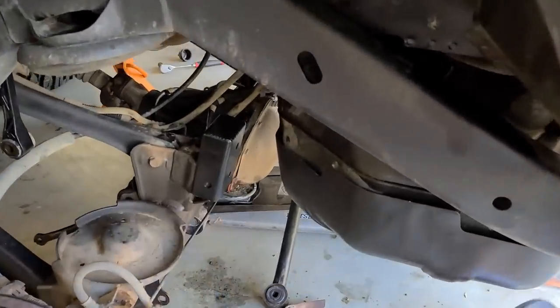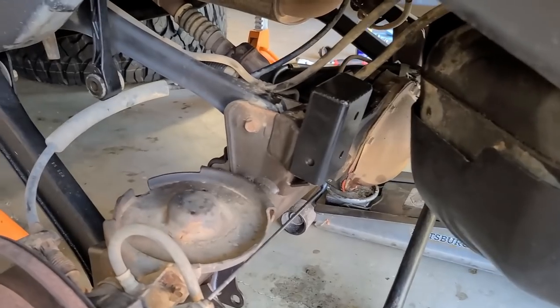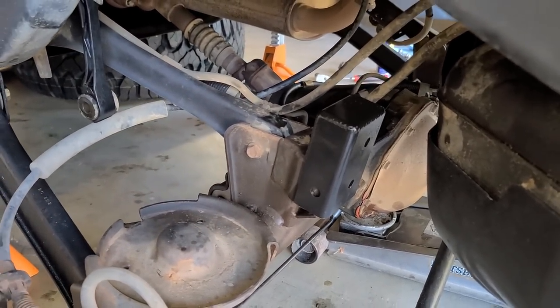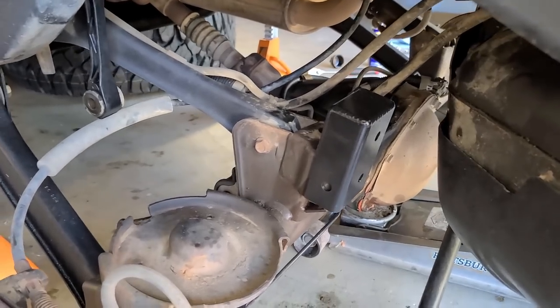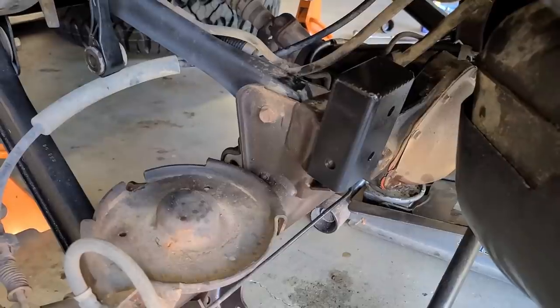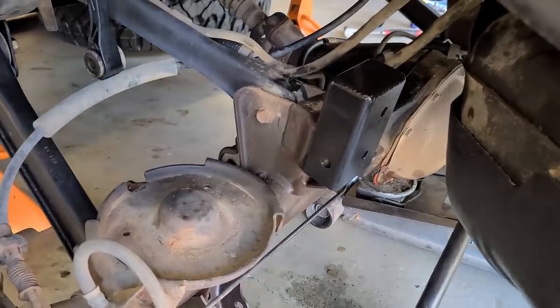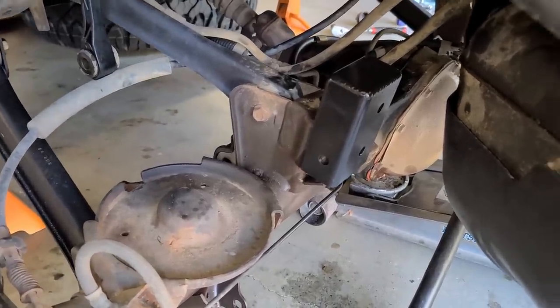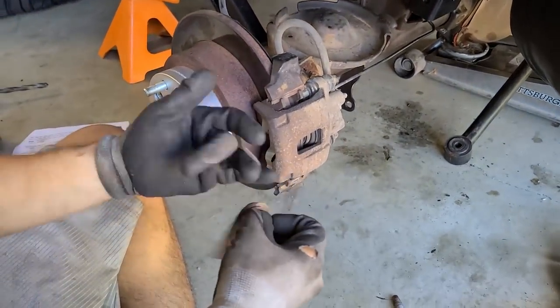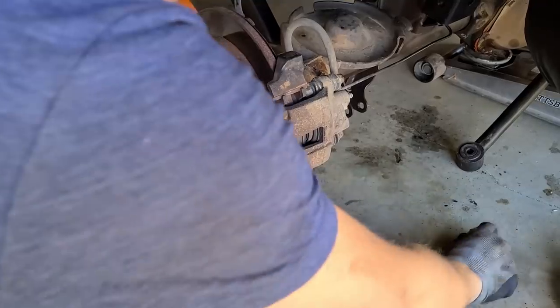This is the track bar bracket into place. It also then says, use the supplied 12x70mm bolt through the OEM lower track bar location using the supplied spacer sleeve with a self-locking nut and tighten the bolt to hold the bracket in place. So, let us do that. Now, let me just see if this fits. Oh, it fits with the self-locking nut.